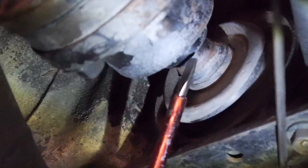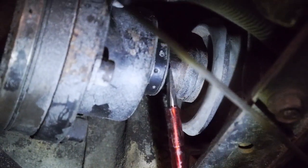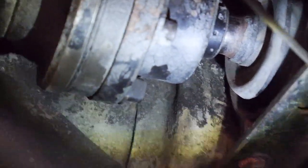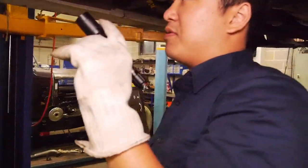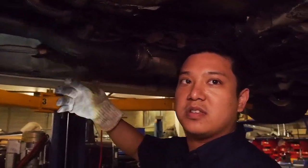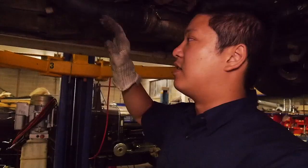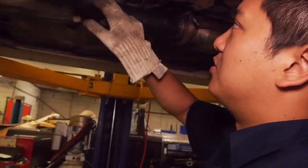That rubber's totally torn. And in here the rubber's totally cooked as well. You can see how much play there is. That could be because the bearings are all dry - all the grease is dry, particularly because it's right next to the exhaust. Your standard lithium-based mineral oil grease used in these joints can really only get their expected life up to about 80 degrees - after that all the constituents of the base oil start breaking down through oxidation and hardening.